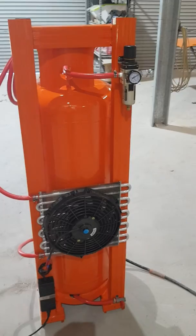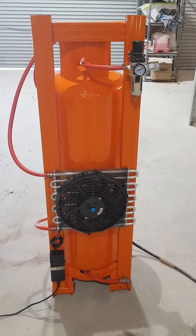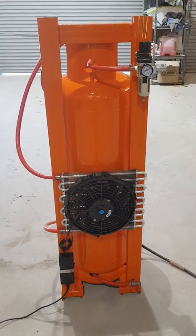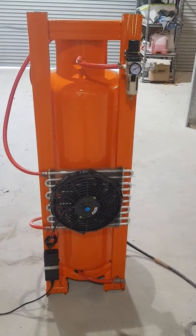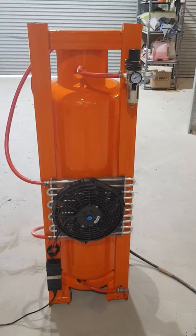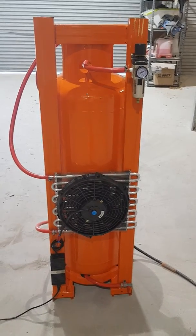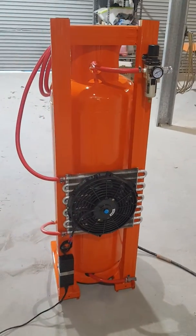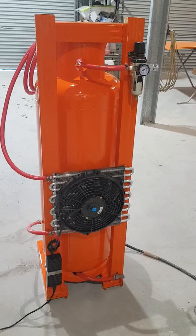What you want is a nice, even, consistent air flow. Because there's so much volume in the system, it takes longer for the air to dissipate when you're pulling the trigger of your spray gun, so your pressure drop is slower. But it also means that when your compressor kicks on, if you've got quite a powerful compressor, sometimes the pressure gets raised too quickly. By adding heaps of extra volume into the entire system, those pressure fluctuations caused by the gun taking air and the compressor feeding air become smaller, so you get a much more consistent air flow. If you're spraying a whole car, you definitely want something like this, especially with a smaller compressor.